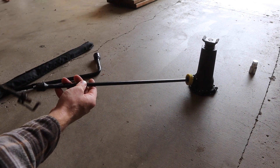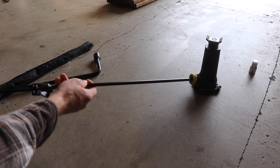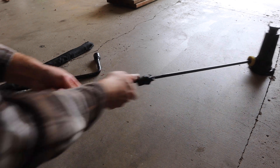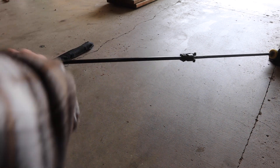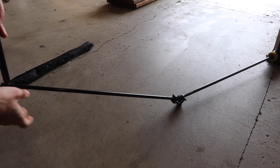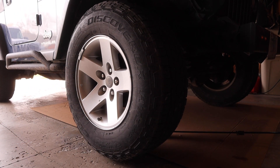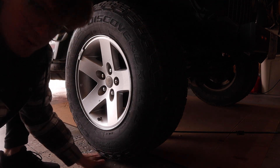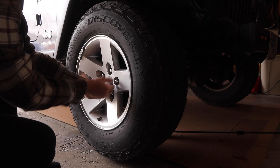It's going to be a little confusing at first how to use them. One piece goes into the jack itself, and then you'll use your tire iron — which you use to loosen your lug nuts — on this too, and the hole goes into one of these pieces. You take one of these other pieces, put it in like that, and then this piece goes like this so that you can easily twist it and it gives you more leverage. Once your wheel is off the ground — it doesn't have to be far, just barely off the ground — take your lug nuts off all the way.